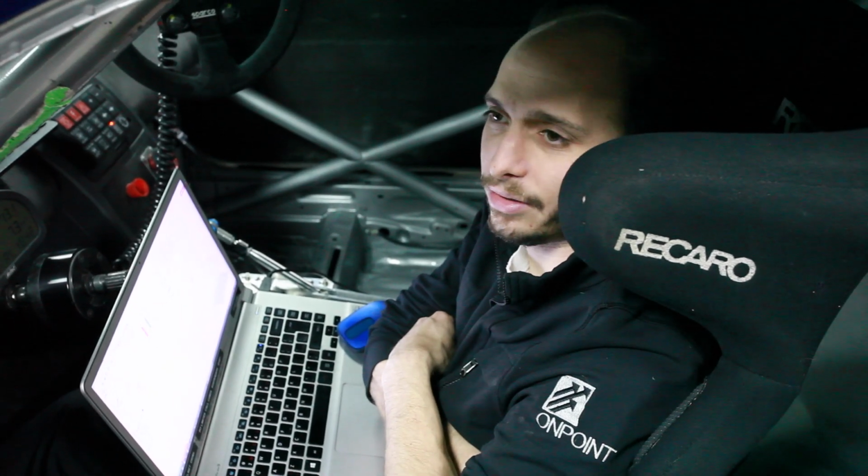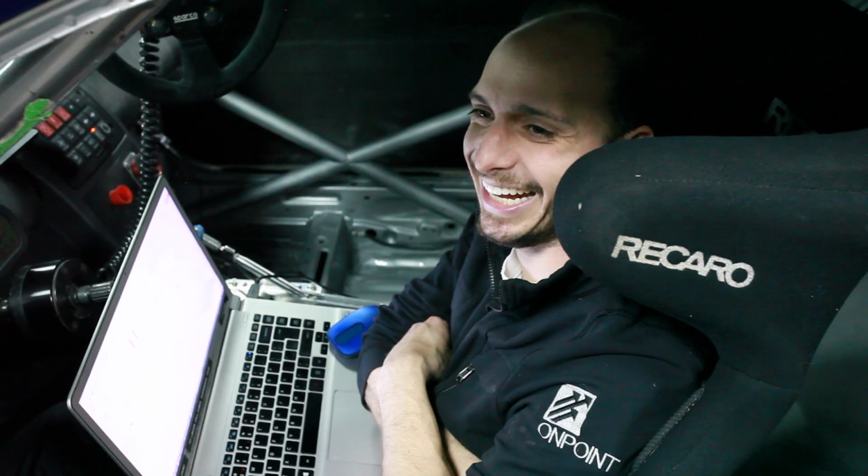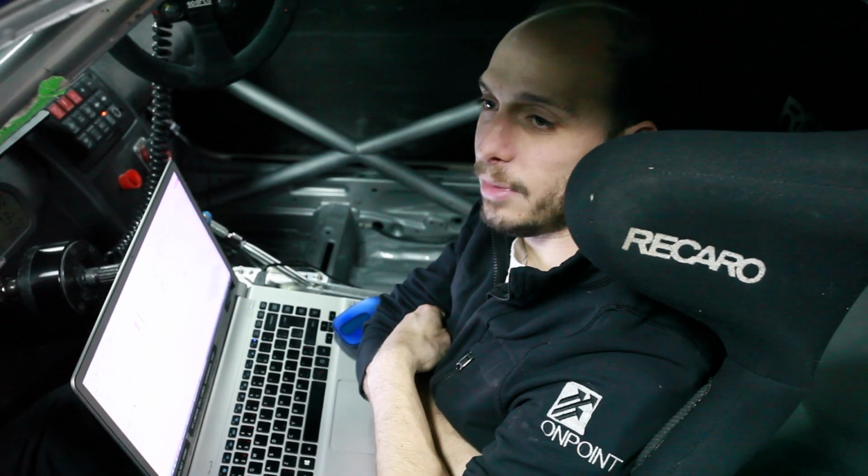If there's still no power there, then we'll have to bite the bullet and order small throttle bodies and do it over again. So you're stubborn enough to try to make the 57s work by porting the heads and building different headers instead of just swapping the 53s back on? Well, 420 was never the goal. The goal is 450. Right. We've got to keep going in that direction. You can see how flat the power band is. So obviously the intake is not a restriction. There's obviously something else that's slowing us down. The 53s are optimized to this current condition, but it's not necessarily going to be optimized once we get the flow that's choking us up here that we're seeing right now.